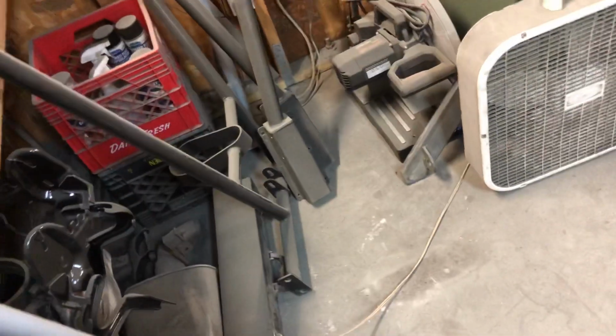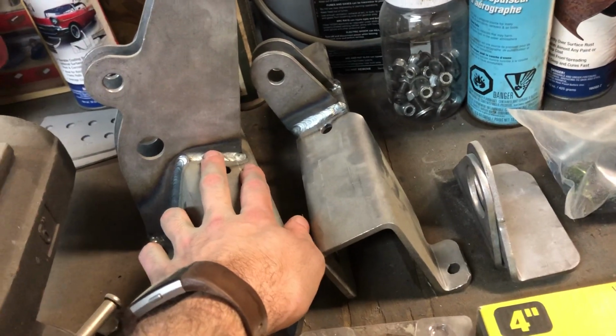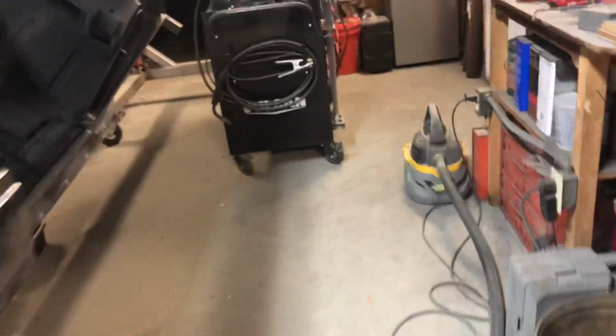It's a different size. Anyways, so one other thing on the TCI wood, and I'll have to show in another video, that I was kind of upset with. The crossbar, I don't know if they forgot to turn the gas on or if some of their stuff's cold rolled, some is hot rolled, they didn't clean the mill scale off or what, but those welds are beautiful on that other piece. The welds on the new one, like on this piece or on these, they are terrible. Scaly, nasty, looks like they just TIG welded it with no gas. I don't know. It's kind of disappointing. But other than that, hopefully I'll be able to figure that out.